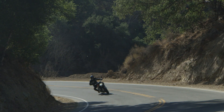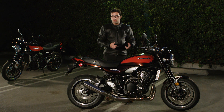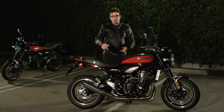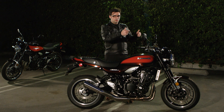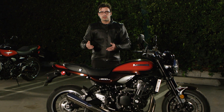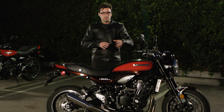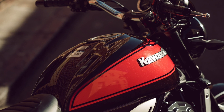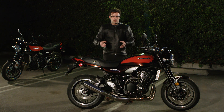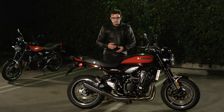This bike is fundamentally different from the standard Z900. The RS version has a few different tweaks to give it its own distinct personality. While it is in the same family, it does things on its own accord and gives a slightly different riding experience. First off is the rider triangle — Kawasaki lowered the foot controls and moved them forward a little bit, and also raised the handlebars up and moved them back. That gives you a slightly more upright, more casual riding position accommodating for just about everyone. I stand at 5'10 with a 32-inch inseam and was completely comfortable. They also narrowed the upper top tubes to accommodate classic stylistic cues like the teardrop tank and longer profile seat, and readjusted the rear subframe. The frame itself is not a direct drag-and-drop from the Z900 — it is fundamentally different and these parts are not interchangeable.